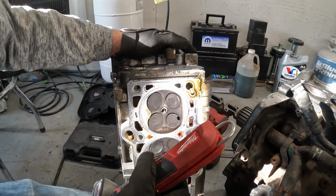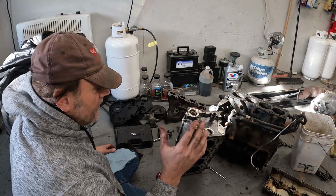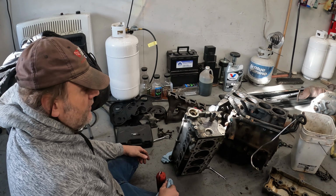And I mean, there's the thing. You have an engine with 140,000 miles on it. Find out you have low compression. If you did a leak down test, you could see where that went. So, could you pull the head off of the motor in the car? Yes, it can be done. To me, you're disconnecting everything except for the air conditioning off of the engine. So at this point, I would just pull the motor.